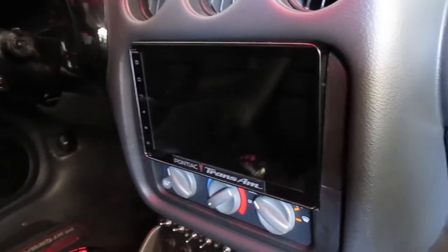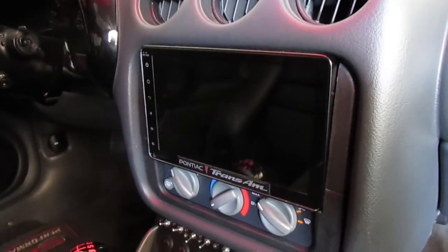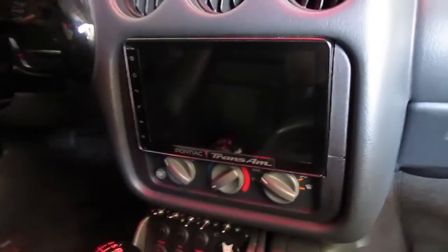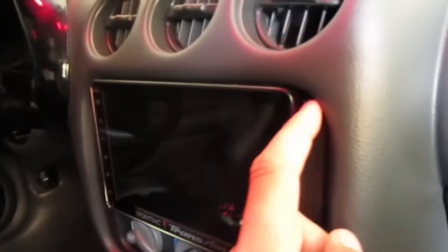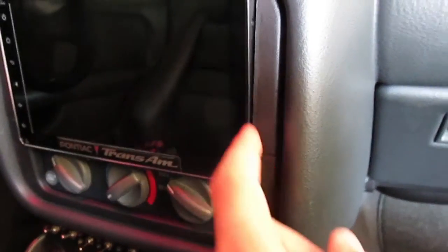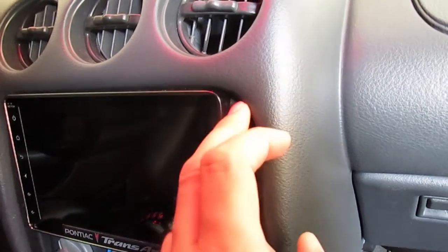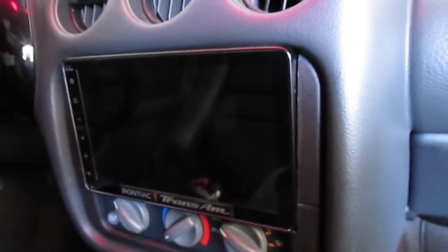It runs Android 4.4 and there are a lot of really big differences that exist only on the 8-inch radios right now. For mounting in a 1999 Pontiac Trans Am, the only issue I had was I had to cut my bezel to get it to fit the dash. I had to cut out the center bar and trim the sides, but since my bezel is curved and gets thin as it goes up, it kind of sticks out on the side, so I actually custom-made another bezel — this is just my temporary one.